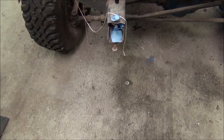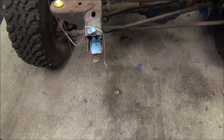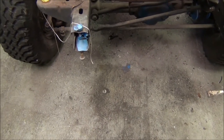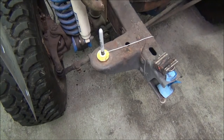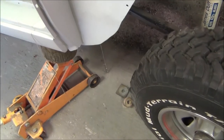So the next step: I'm going to plumb bob all my body mounts, mark them on the floor with a Sharpie, then push the truck out. I'll have to vacuum up all that crap first so I'm working with a clean shop floor. I've got a mark on the ground there — a Sharpie makes a good tool to jam in there to get your string just right where it's very close to the ground. I'm going to do all the body mounts that way.